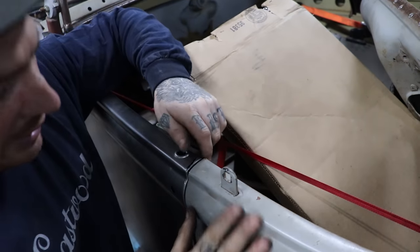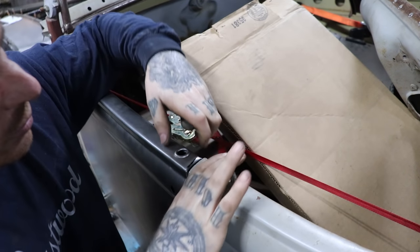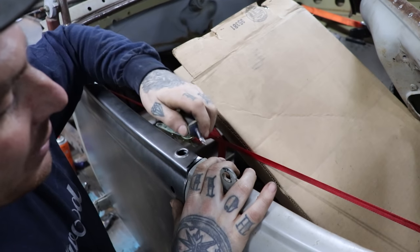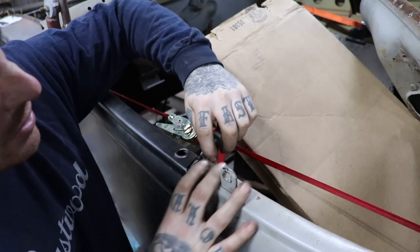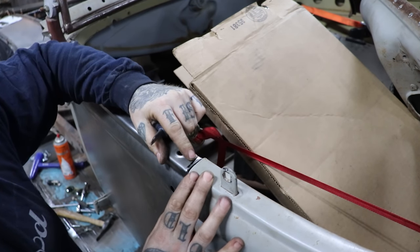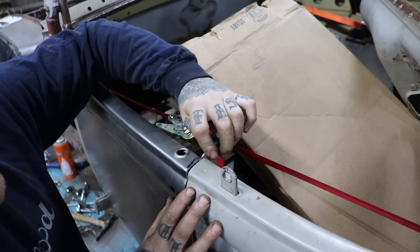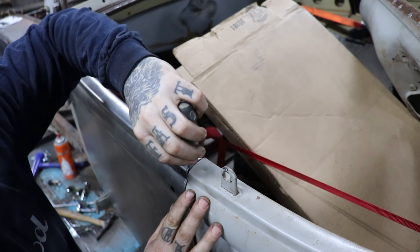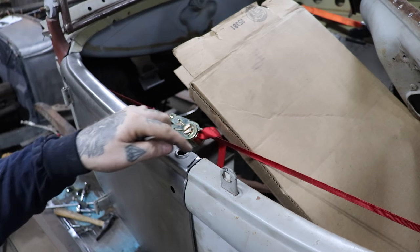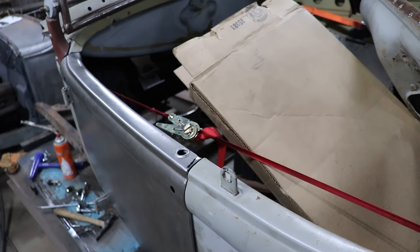So I got the door latching, pretty happy with everything overall. We're not going too crazy on this car, but we want everything to latch and at least sort of look good. So what I'm going to do is try and hammer and adjust this little sliver here - I'm going to obviously leave a decent gap, just twist it to get it sitting flat, and then I'll just lay a little bit of filler rod in there and we should have a door that opens and shuts and fits pretty decent.